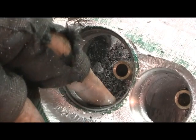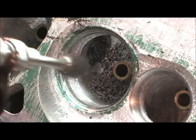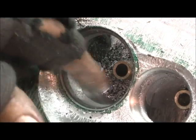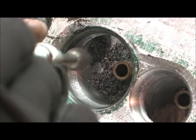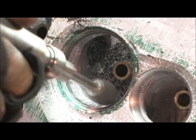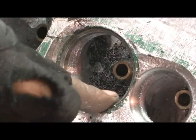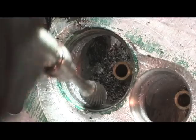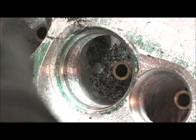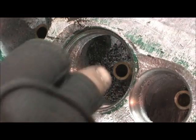What you're going to feel when you do this is a big hump where the aluminum — of course the cutter is going to touch the aluminum some — but it's changed the steep angle, which is what we were trying to do, and not have as much fillet or as much turning radius on a high RPM motor. I wouldn't go no more than about 15 degrees. You start putting more of an inclination into it, you can get yourself in trouble real quick. I just wanted to show that part and how I do that for the bowl, so that you know this head is getting everything thrown at it — from raw material removal that is insane, to cutting on the seats.